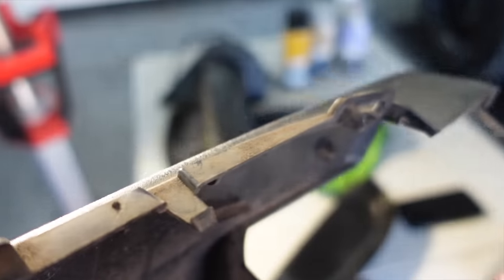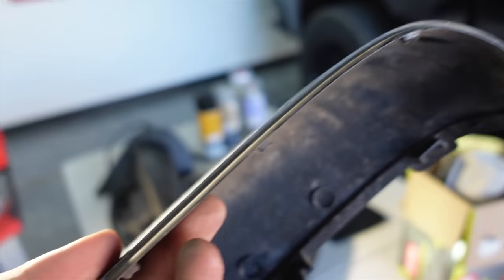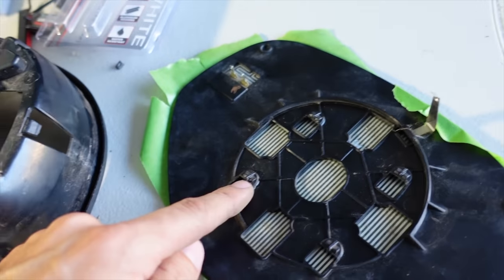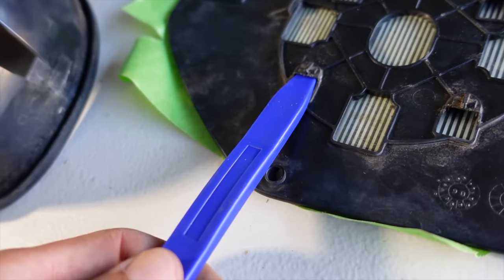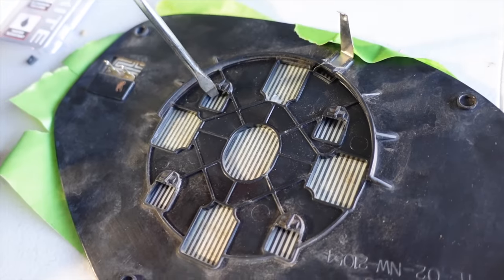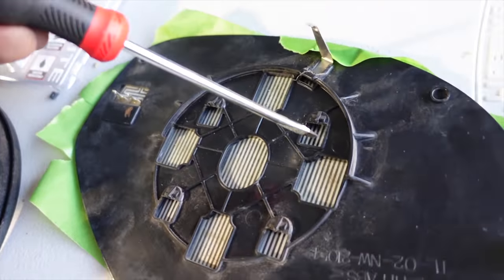On the bottom side, there is also locking tabs there, which you can actually access once the top's gone. Push that down, pop that out, and then work this out real carefully. The mirror is hooked in four locations, here, there, there, and there. It locks itself down by sitting like that. And given this mirror was sitting here for about 15 years, we did have to kind of persuade it to come off very, very carefully. Got underneath these little perches and just basically broke them loose. This is glass, be very careful or else you're gonna be back on eBay ordering yourself a new one.